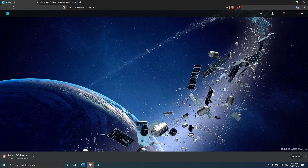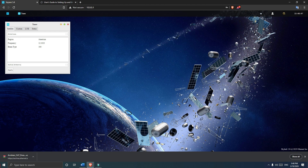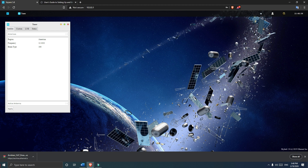Now let's check out what is available for us in OtherNet. Before getting started, we need to check and see if we have a signal lock. We do that by clicking on Tuner. The satellite tab will show you the proper frequency and beam for your location — change it accordingly. For North America, the frequency is 12.1032 and the beam is 164. I am located in the US; I can only vouch that this works in America. If any of you are located in Europe and would like to share your experience, please feel free to put it in the comments section below.